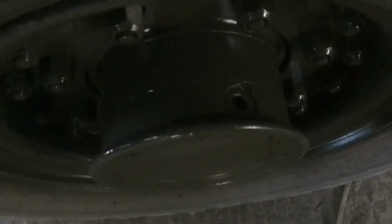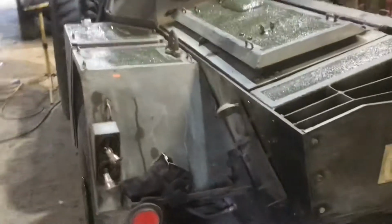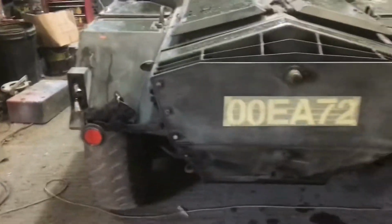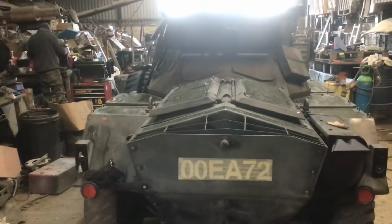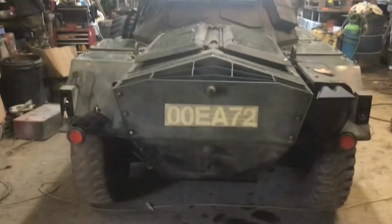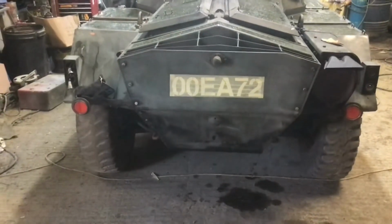Informative video, this one. If you're expected to be excited, well, be disappointed. This is about learning. And then this one here, just there. When you're buying a Ferret, always make sure your hubs line up. Otherwise, you've got a 3-wheel drive Ferret. That's not strictly true. But when you put the hubs on or do the bevel boxes, you should always make sure that the hub fillers line up. It can be 4-wheel drive, but it's shabby.